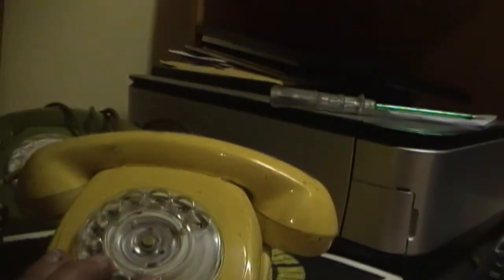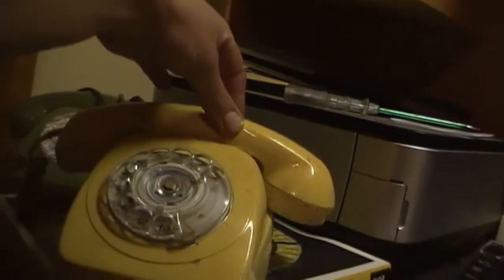After much fiddling, I've worked out how to fix these old phones that I also collect. I've got a couple here - this one's for Alex, this is what I'm doing the video on. There's an old black one up there that works, I've got that working, those two down there, and there's a few more in my room and around the place. Because what happens - they are wired for a four-wire system. You can hear the dial tone, but when I go to ring it, the bells won't ring out. The first one I got, I thought the bells were stuffed - that's why I got it so cheap - but it turns out that the bells are actually fine and it receives the phone call fine, it just won't ring.